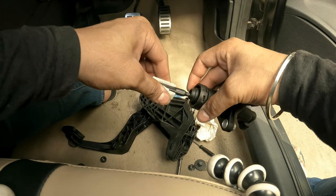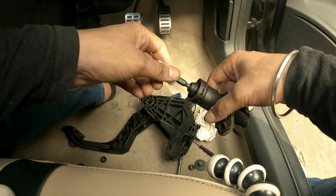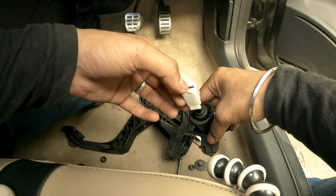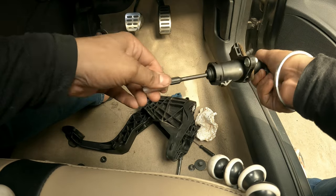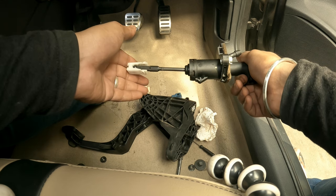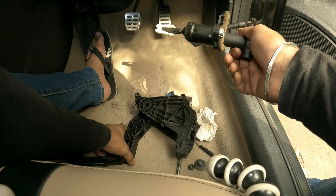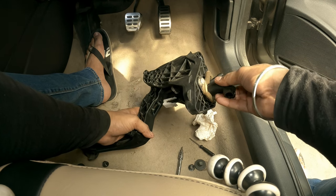Some of you will be thinking I said we need to grease this but didn't show it — there is a spot to grease since it's open, so I'll grease it there. The master cylinder has two states: a collapsed state and an expanded state. You are supposed to put the master cylinder back on in the collapsed state because it's much easier. The only thing left now is to put the master cylinder through here.